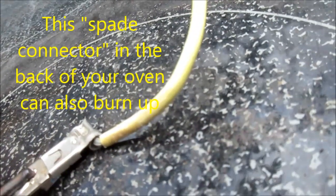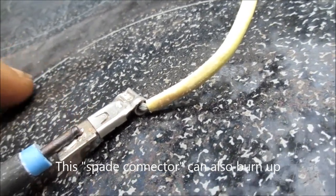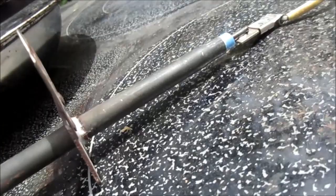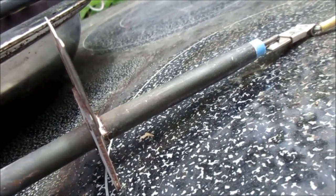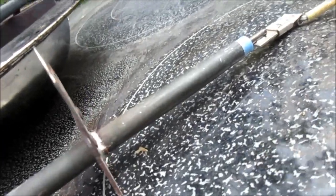Basically the heat element — the inner liner — this is it. This here is actually the heater, and it goes in between that. What's happened is the insulator has deteriorated and then the element itself in the middle has touched the outside. Sometimes this can be a shock hazard, but it normally just blows the fuse or burns the element so that it's not connected in the middle anymore.